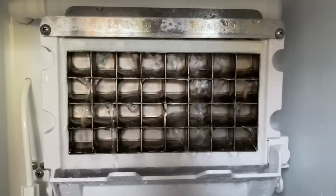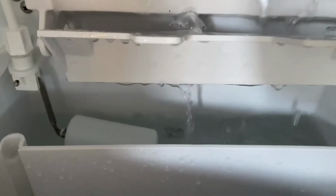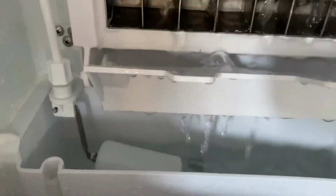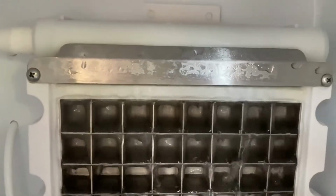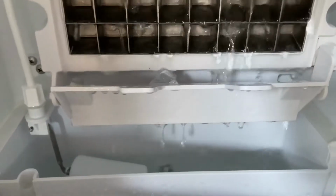It's totally different from the traditional horizontal ice molds that we're used to that fill with water and it dumps when frozen. Instead, the tray remains vertical and it's technically called an evaporator. The ice maker has a water trough that holds a fixed amount of water. From there, the water flows to the freezing evaporator surface. The portion of water that doesn't contain mineral impurities freezes and sticks to the ice cube molds.